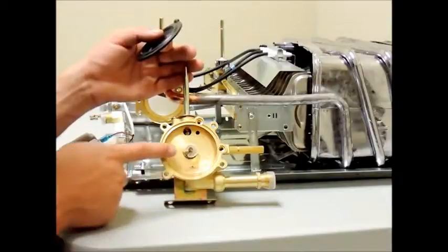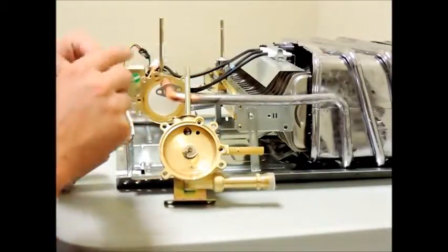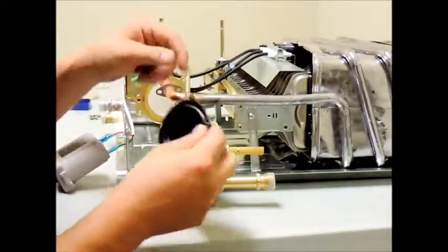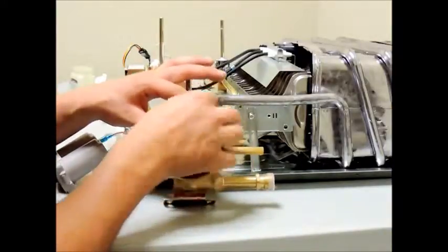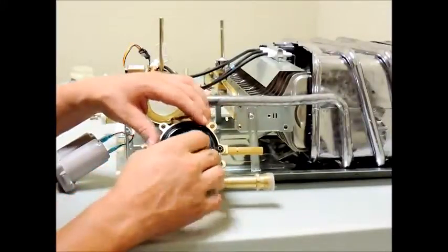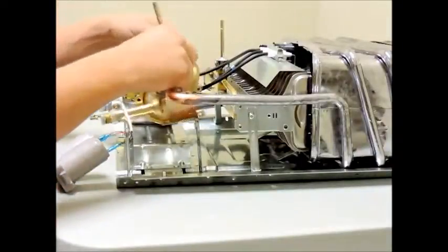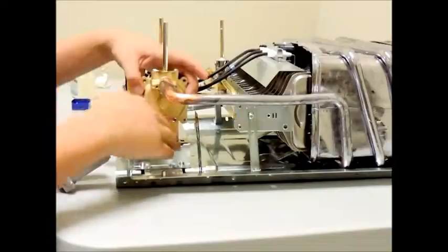Now to start reassembling the parts. Apply a very small amount of petroleum jelly to the inner lip of the removed section of the water valve. This is to help hold the diaphragm in place as you reassemble the water valve and help prevent pinching the diaphragm. Please note to place the diaphragm into the water valve assembly correctly by placing the diaphragm with the concave side facing out in the removed half of the water valve assembly.